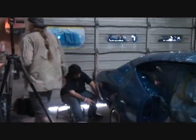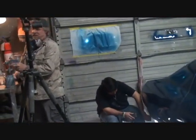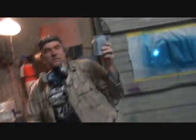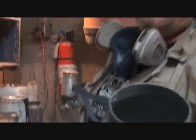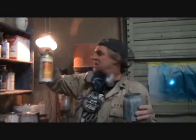This is Pete — my friend Pete, your friend Pete. We've got Minnie the Body Shop Girl, we've got 972 — how's it looking? It's looking good, almost done. Color sanding and hopefully making it look good. One more thing I want to tell you: once you mix up your epoxy primer — I went ahead and mixed a full quart just to show you how to mix up the ratios — but if you have any epoxy primer left over, anything that requires a hardener and anything that requires a catalyst, you cannot keep. It's trash, throw it away. Make sure that you clean your gun out thoroughly and ready for the next job.